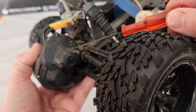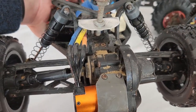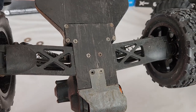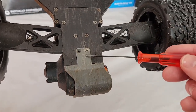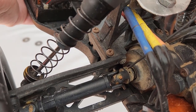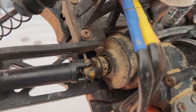This is your motor and gear cover — there are three screws you need to take off: this one here, this one here, and this one here. That removes the cover which exposes the motor. To remove the whole assembly — the motor, the transmission housing, and everything — it's very simple. Remove these two screws from the bumper piece and then these two screws up here; this is what holds the transmission assembly to the body. Underneath there are four screws that hold the whole transmission assembly in. Before you take it completely off there are two more little tiny screws — that little screw holds your axle assembly to the shaft connected to your transmission gear. If you rotate this you'll see on the other side where the pin comes through.